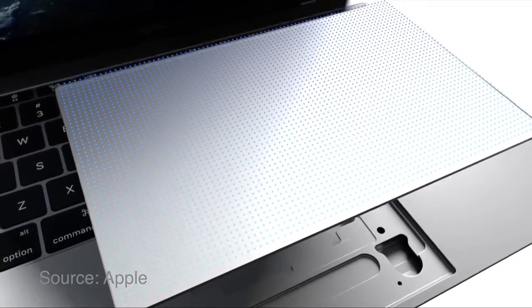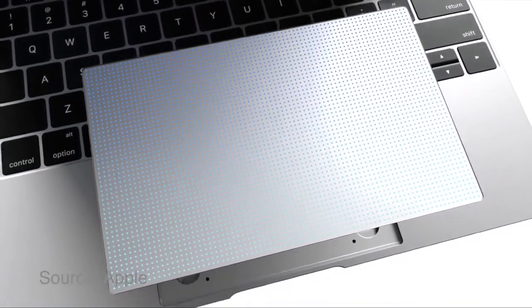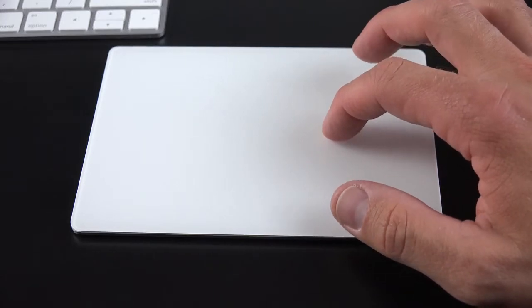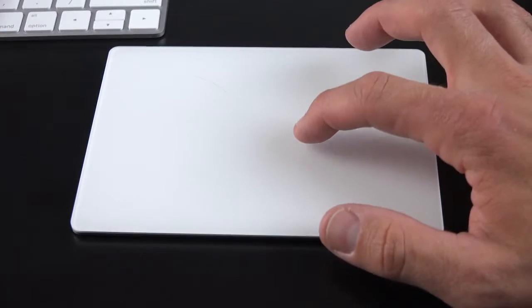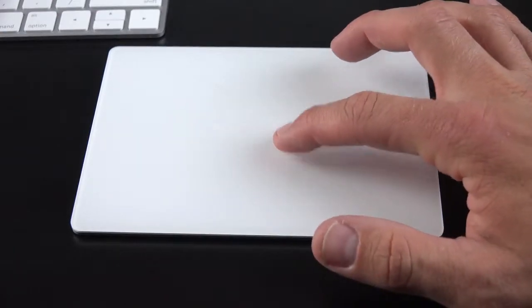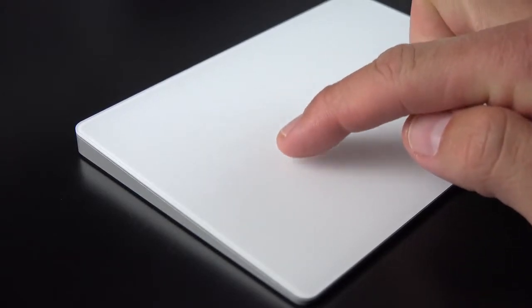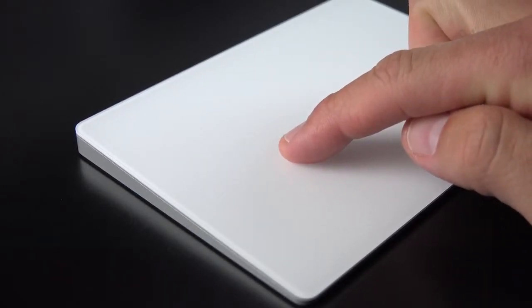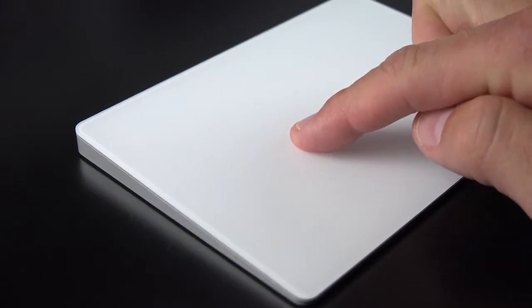This also makes the Trackpad 2 pressure sensitive. This works with a new gesture within OS X called force clicking. The unusual thing about Force Touch is that it's completely indistinguishable from a physical click, even though nothing is actually clicking on the trackpad. In fact, if you turn the trackpad off, that force clicking completely goes away. As soon as you turn it on, you get both the auditory feedback from the click as well as the physical sensation of clicking.